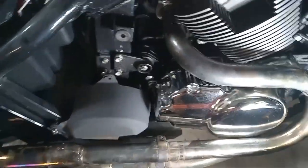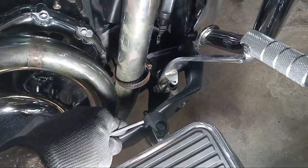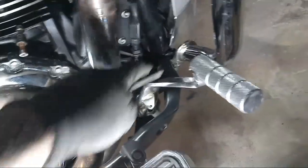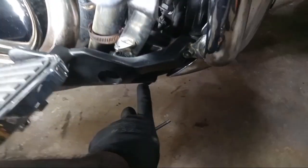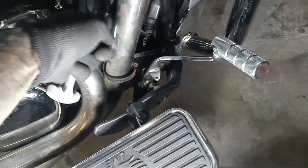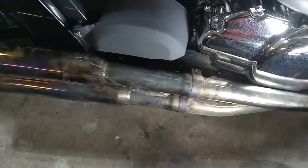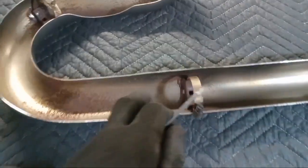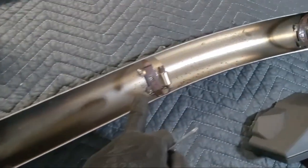You can see the two pieces of fairing there. Coming back down here, the brake and clutch assembly is pressed up against it, so you're gonna loosen the bolt here and the bolt here to push that assembly out of the way so you can pull out the exhaust pipe completely. The heat shields are held on by clamps — you've got five points of contact.